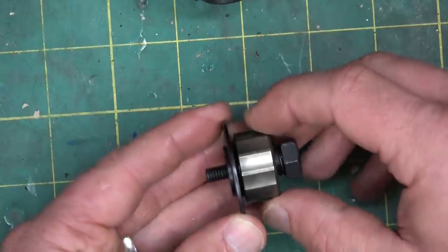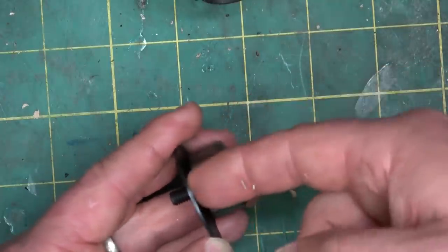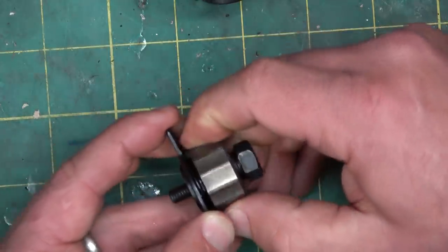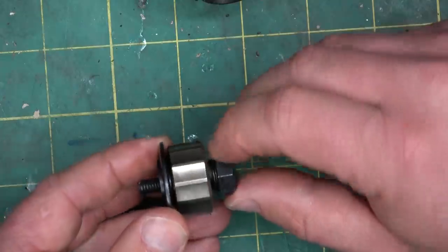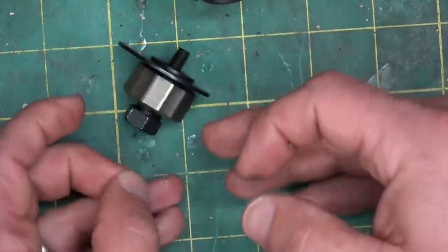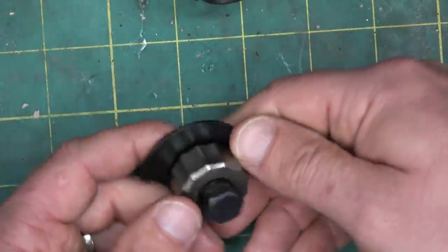And we can see there's a bunch of springs. What's going on here is when the bolt engages so far, it actually doesn't engage on this Archimedes spiral. It doesn't clamp the spiral down. The spiral is relying on a heavy spring in there to give it its tension. It's impossible for this mechanism to overcome the spring tension and clamp down on that. So you're only ever going to get a preset amount of tension out of that Archimedes spiral. And then when we actually bolt it up, it locks up solid on this spigot and the bolt head, and that's how we get it to fix properly while still maintaining the correct tension on that chain.